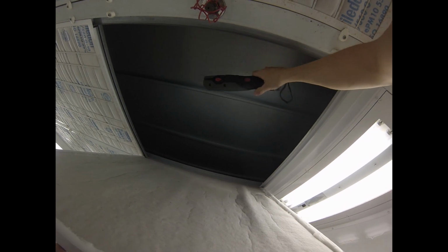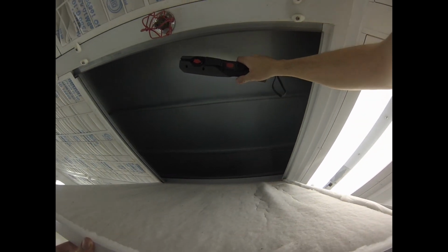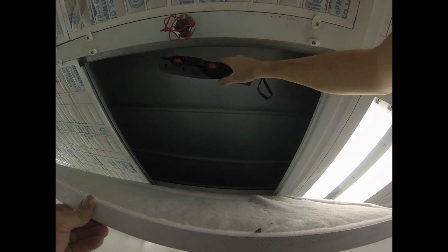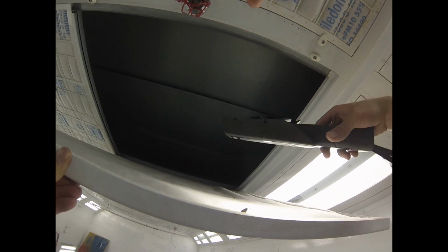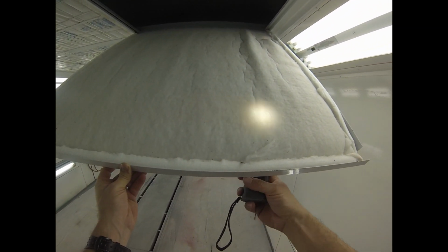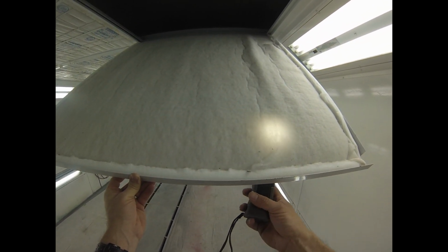And you can see up there, that's the plenum that distributes the air across the top of the booth. And it does it pretty evenly without any like special ducts or special diverters or anything like that, because these filters are so fine. It takes a lot of pressure to push the air through them. So it's kind of the filters that distribute the air, because they're the big restriction in the intake to letting the air through, right?